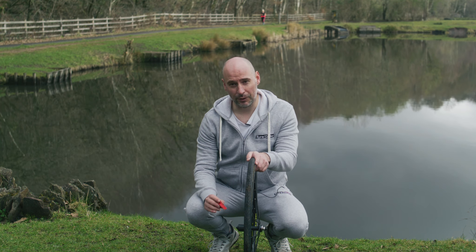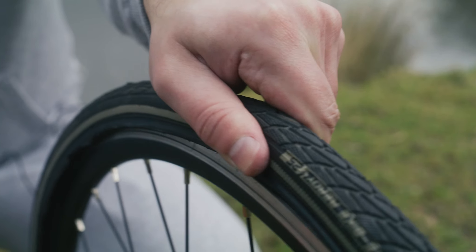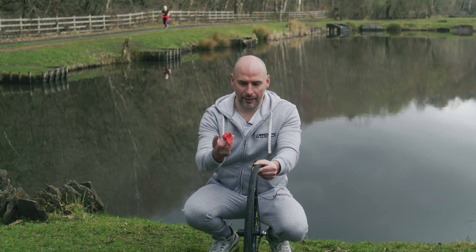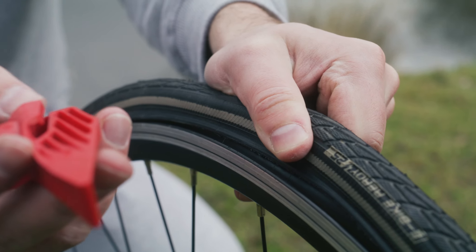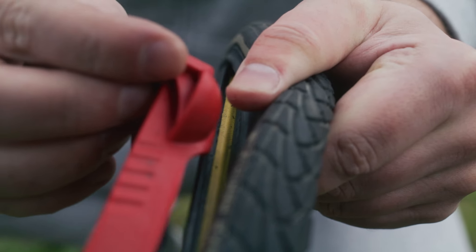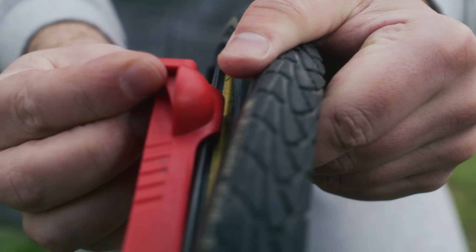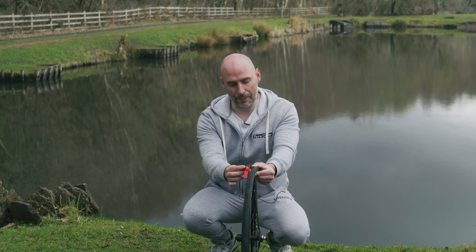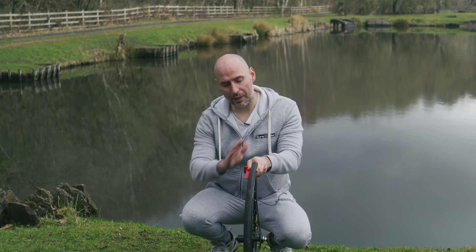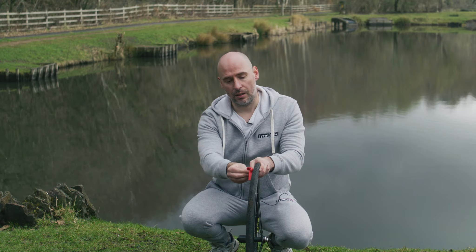The next stage now is to put the tire back onto the rim. What you need to do is pull your tyre over to expose the rim edge. With the Tire Glider, you're looking at this gap here, and what you need to do is fit it onto the rim. You may need to angle it for thicker rims, and it just engages onto the rim. From this position, I tend to use my left hand to push the tire down into the rim channel and push forward.